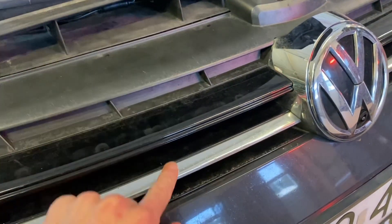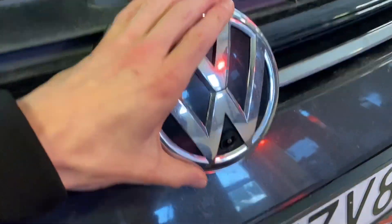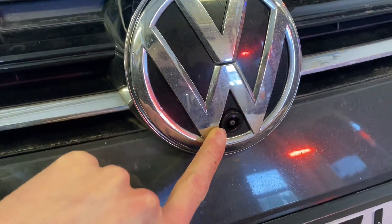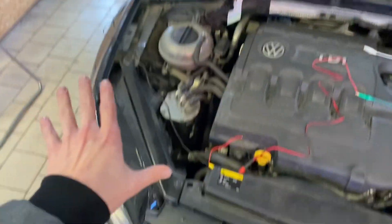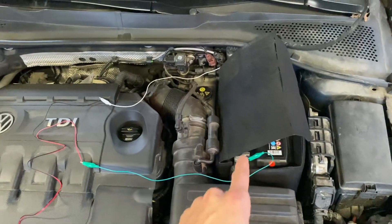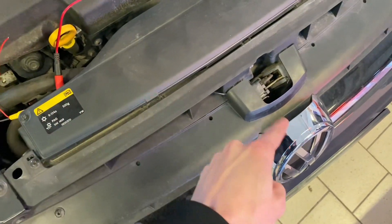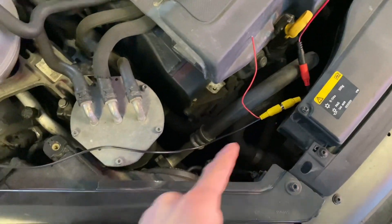This whole element with the badge goes straight out. Then, as I said, you drill a hole and place the camera. Right now I have my test setup with a bunch of wires — I have power from the battery, power and ground connection to the power connector of the camera wiring. This is just a temporary solution, and over here I have the video feed that goes into my vehicle.